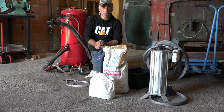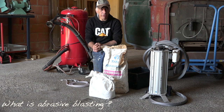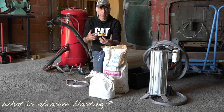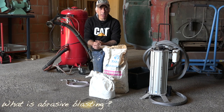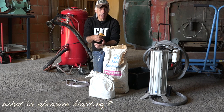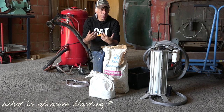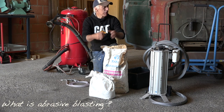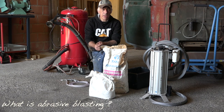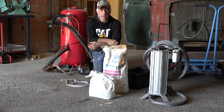So what is abrasive blasting? We used to call it sandblasting, but nowadays it's called abrasive blasting because you can use different products to actually blast paint or rust off a surface. Now there are different products that you can use, and it's a bit like your paint gun. If you have a paint gun, you have compressed air, and that compressed air carries the particles of the paint, and then they hit the surface of a car or a door or whatever you're trying to paint. With abrasive blasting, we do exactly the same. You have a high velocity airflow, and that airflow carries small abrasive particles. And there are all kinds of abrasive particles, and we call that media.